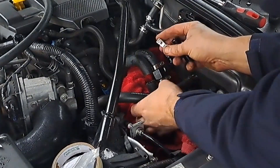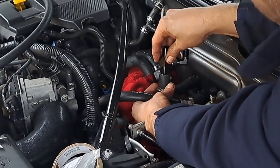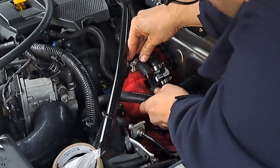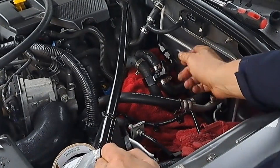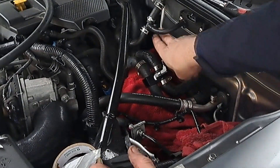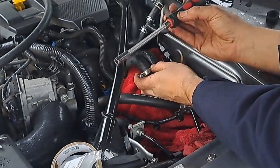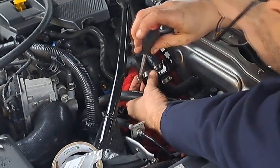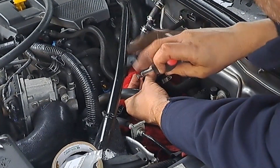Remember to put your hose clip on around the right way - don't want it fouling on that side. They've been as easy as pushing in like that. Put the other clip on the other hose and push that one down. This is snug. I kind of want to send it across like that so hopefully it'll go neatly through here and along the back section. When I ordered some hosing stuff I finally ordered a jubilee screwdriver - I've been working on cars a long time and it's about time I got one.